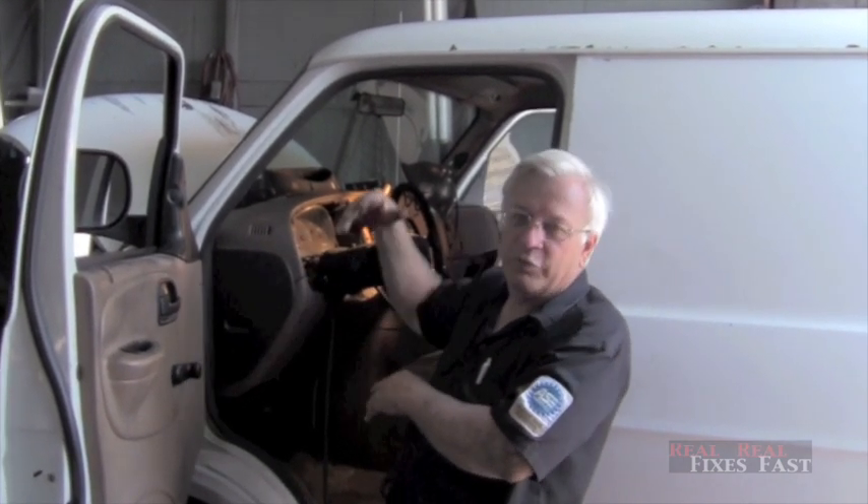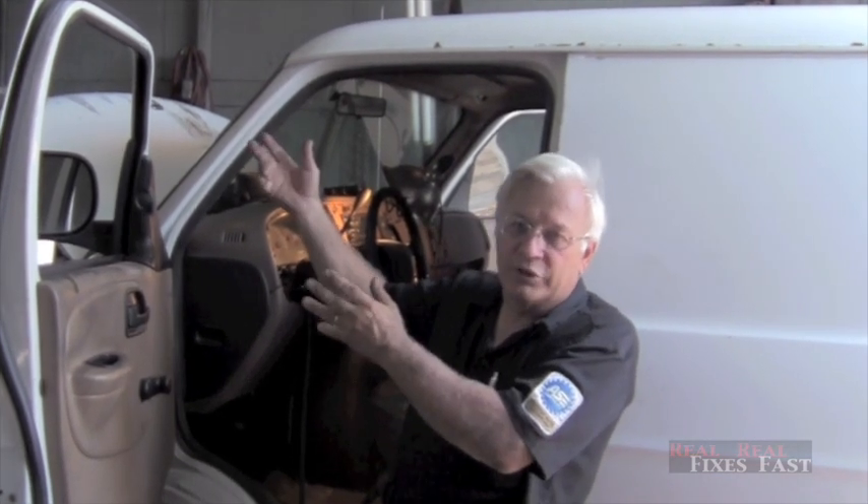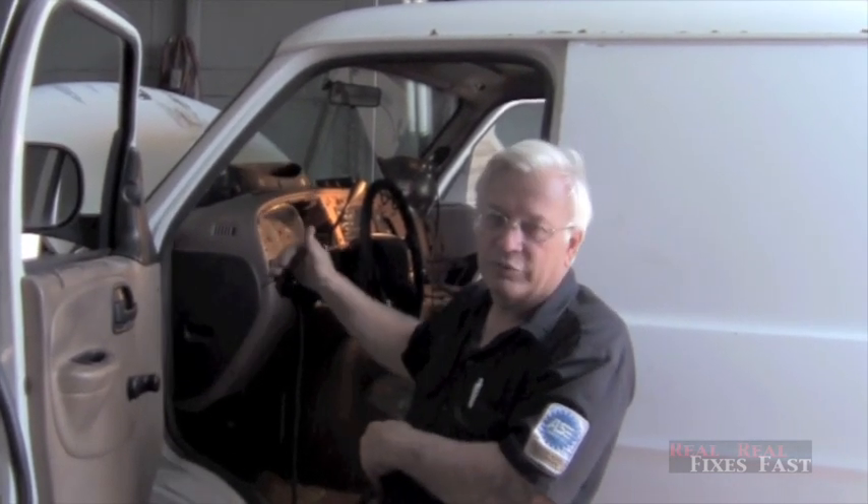It's a hot day. We just happened to have another vehicle come in with a very similar problem. In the first case, the air conditioning was working right, except when you would accelerate or go up a hill, you would lose your flow out the vents and floor and default to defrost only. In this case, that's all we have — defrost at all times. We can't change from the vent to the floor. It's still a vacuum-controlled system, so since we're defaulting to defrost at all times, my suspicion is not whether it's the canister holding vacuum or the check valve leaking — it's whether or not we actually even have vacuum there to make the control valve work.